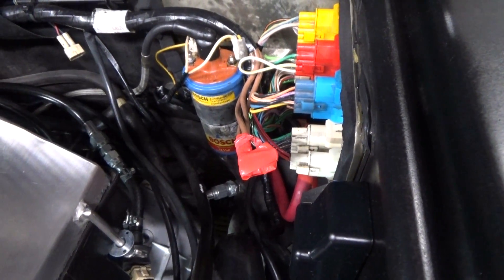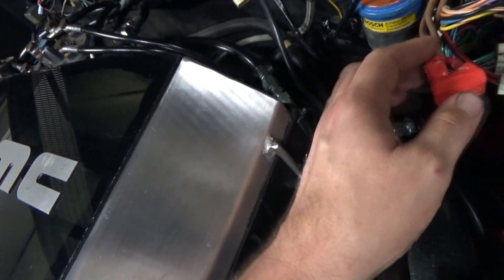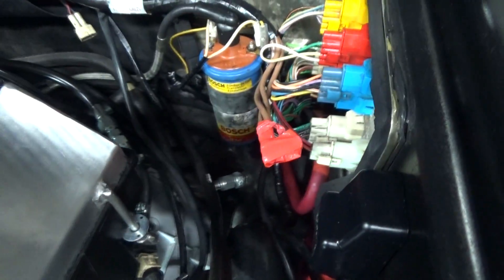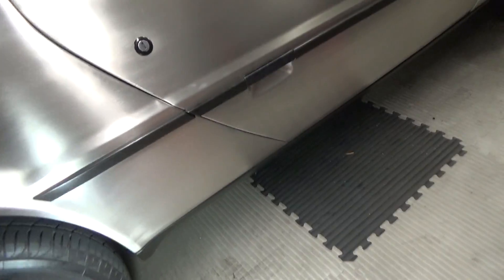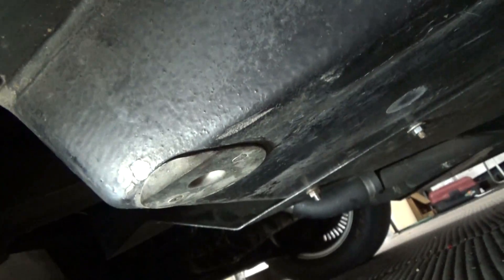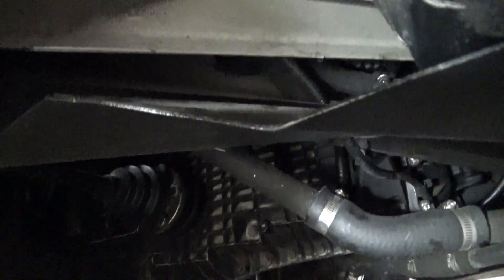This comes along here and is connected to the frame just in front of and below the coolant reservoir bottle. There's the bolt right there and this ground wire goes from there all the way to the bulkhead. It looked like it might be eight gauge wire — I went ahead and went zero gauge just like I did with all the other main battery, alternator, and starter cables, upgrading everything to zero gauge welding cable which is 100% copper.